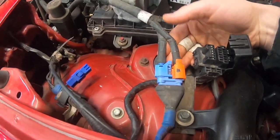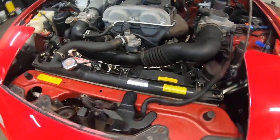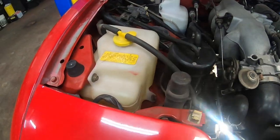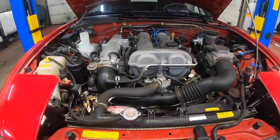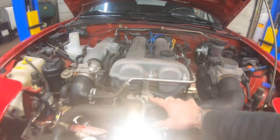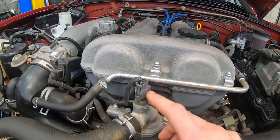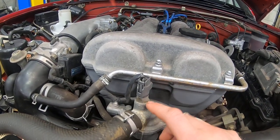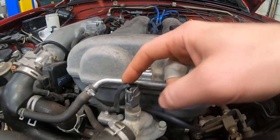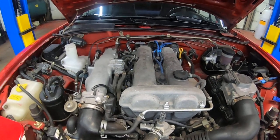You've got some connections here for your airbags, otherwise not too much on this side. As we come across the front, very standard layout for all Miatas — you've got your radiator and the line going to your overflow tank. The 1.6s are unique in that they have a temperature sensor on the thermostat housing. This is the one that controls the fans, so if something goes wrong with it, your fans may not work. This wire can sometimes get corroded, and if there's an issue there it can cause your Miata to overheat.